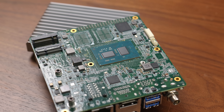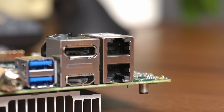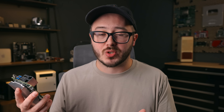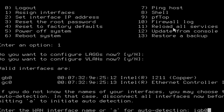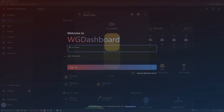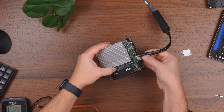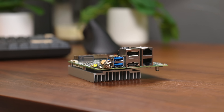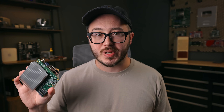Normally I wouldn't be that interested in a board like this because I don't do a lot of maker stuff, but it does have a fairly modern CPU and dual NICs. One of the first things I thought of was setting up a very simple low-powered router — one NIC as WAN, the 2.5 gig port as LAN for inter-VLAN routing. You could also set it up as a lightweight server running something like Home Assistant, or use it in a small passively cooled cluster with dual networking. Let's check this thing out and see if it's worth the $63.